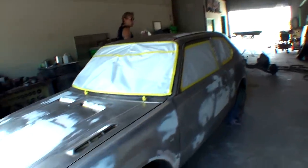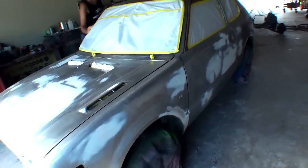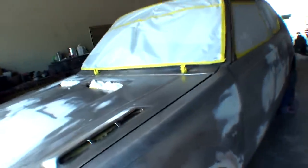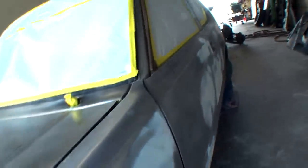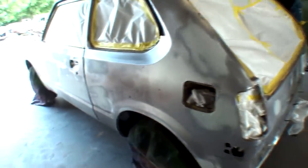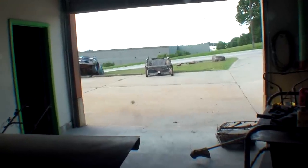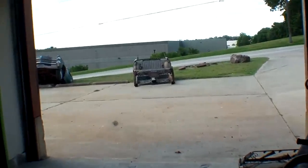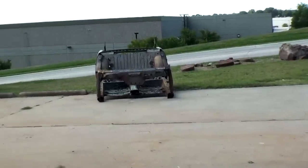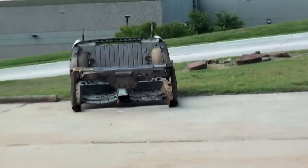Let's go ahead and wrap this up. That's what you're looking at - hand stripping and soda blasting right here. You can see how beautiful it came out. You can see the texture of the metal. We still got our factory etching that has been applied to the car, which will protect it for many, many years. And this is the way to go. We're not putting any epoxy primer on it. We're not going to put anything on it at all. We're going to go straight into 2K primer and be done with it, versus sandblasting where you have to immediately put epoxy primer or some type of sealer on your metal once you get it back. And if you don't, it's going to rust. We'll see you later. Take it easy, my friend Pete.